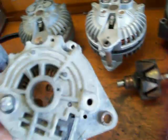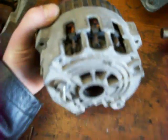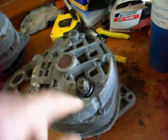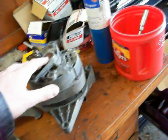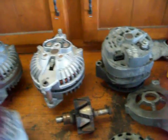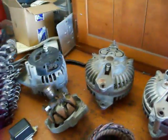Usually you don't have too much trouble with the stator or rotor itself, though I have seen one actually melted at the diodes. Another thing that can cause the alternator not to work is the voltage regulator, and any wiring to it. Dirty connections at the plug or improper grounding can cause the alternator not to work. And something often overlooked is the belt and belt tension — if the belt isn't on there nice and tight, it can slip on the alternator pulley and the alternator won't put out what it needs to.